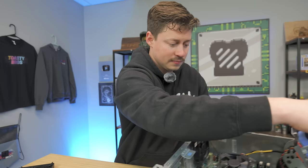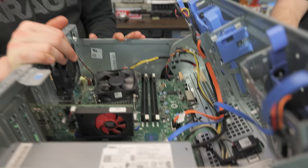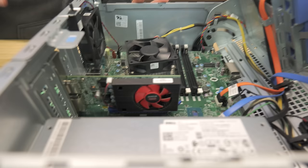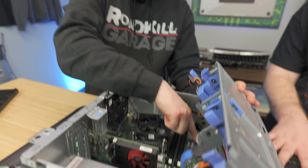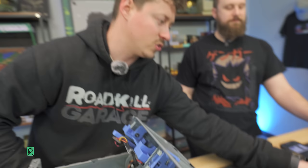As far as RAM goes, we are going to be upgrading it. We bought it with an 8 gig stick but removed that for the video, because this actually has four RAM slots. We get one PCIe lane that is a full-size x16 Gen 3 lane. For storage, we saved money by not buying one with storage and we're adding our own — a Silicon Power 1TB 2.5-inch SSD.